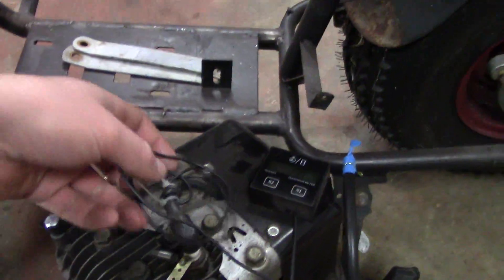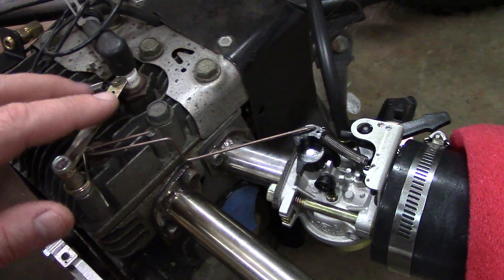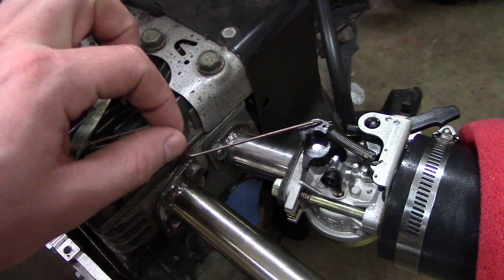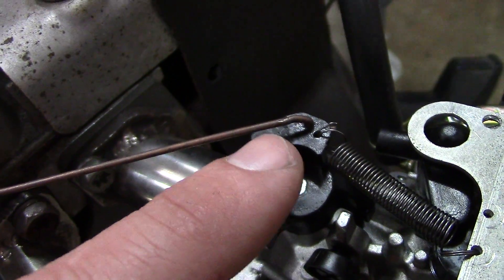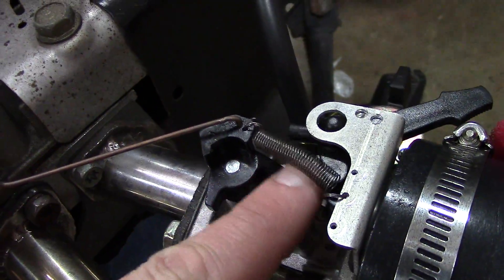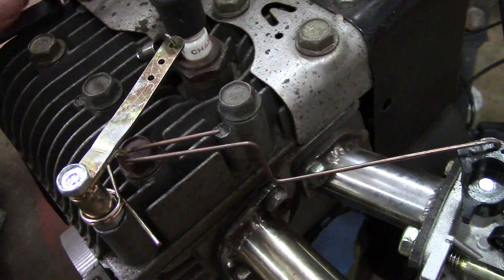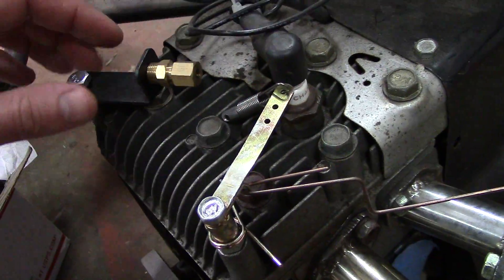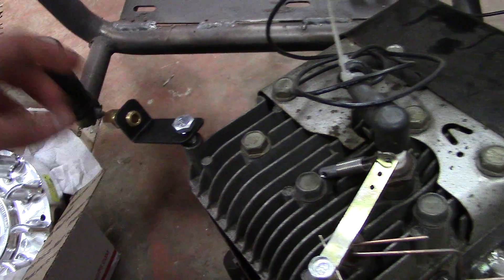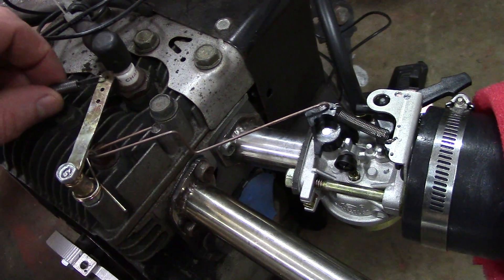I've also made a little progress on the engine where I've got the direct throttle linkage kind of set up already. I just used a piece of TIG welding wire — 1/16th inch wire — and I cut off part of the bracket for the carburetor, and just used a little generic spring to return the throttle. This will eventually hook into where the throttle cable is here, so when you pull on the throttle, it'll open the carburetor just like that.